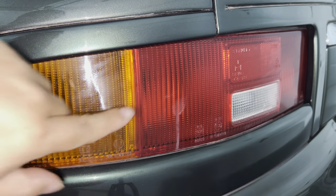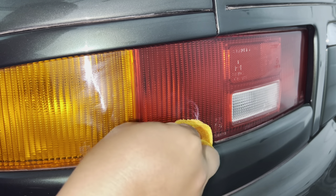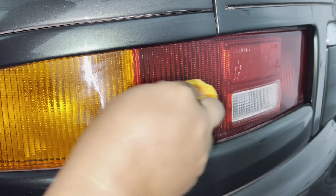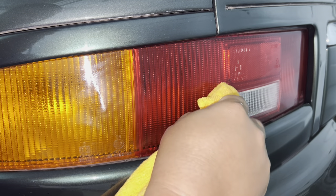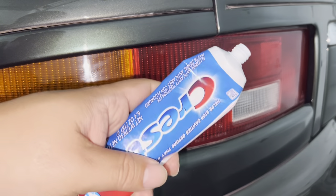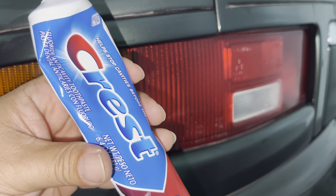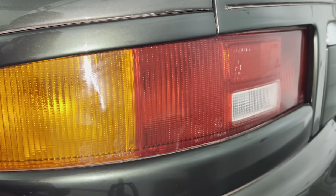And it also smells like minty goodness, so that is a pretty good result. Now I'm just going to put another little dollop right here and go after this lower one that seems to be kind of persistent. Just putting finger pressure on it, counterclockwise, clockwise. I don't want to get any streaking - it's slightly abrasive. Clean edge of the cloth, and then maybe a little water or cleaning solution just to clean it off. But look at that - the lens is clear! So, little household hack for getting scratches, swirls, etching out of lenses. You can probably use this on headlights too. A lot of things can work like a polishing compound, and I had a Crest around.